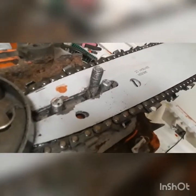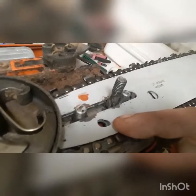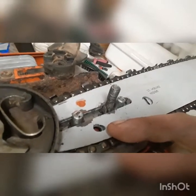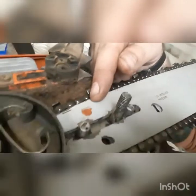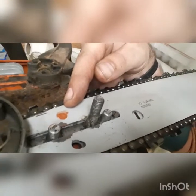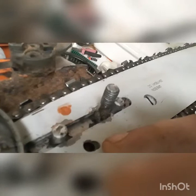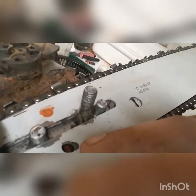What you have to do is file a groove in the tension hole. I just got started on this project — once you have your groove made, you then have to make a plug. There's the groove, so it meets up with the oil pump flange rubber gasket. I plugged the backside with some silicone. I'm just trying it out today, but putting a little diagonal groove there should allow the oil to flow.